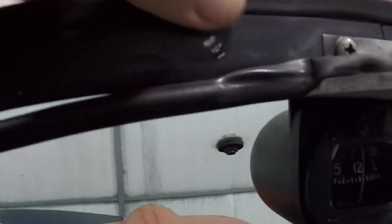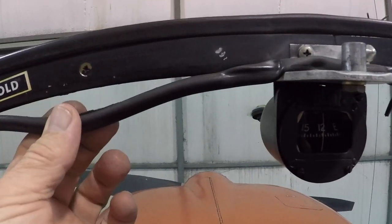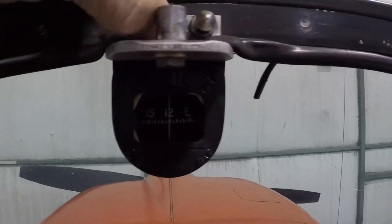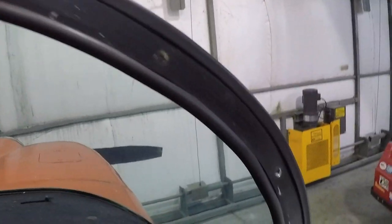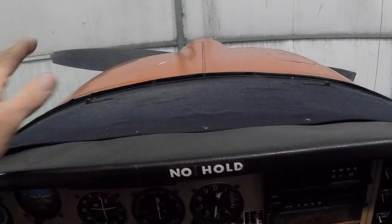While we're doing the windshield, let's take a look at the double bead seal. The top of this double bead seal is dead — it's completely flat and has no resiliency left in it. You can also notice that the bottom bead is starting to come loose, and for whatever reason the factory did not trim out this one section. So we're gonna be removing this old one.